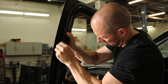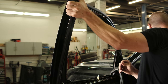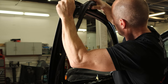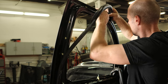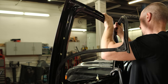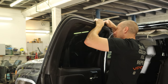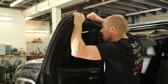Now we have to pull the gasket off around the outside of the door. If you're working for insurance you just break all these little clips. But since I don't want to have to buy each one — the gasket is shaped like a T — you pull the gasket enough that one side of the T comes out, pull it away from the door a little bit, then slide it back down. Keep repeating that for each one. Putting them back on is the same way. It takes a little time, but you're not buying all these clips. Even if you try to take them off you get about 20% of them, and of those probably 50% are no good because they get stretched out. The ones that do break leave plastic ends in the door to rattle. So you've got to slam the door a few times until they settle. To me it's worth spending a little extra time to fight with this gasket.